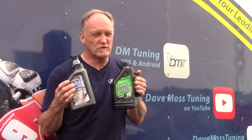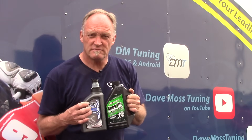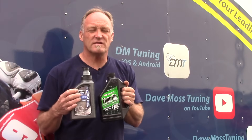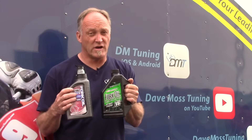Fork oil is cheap and you're supposed to change it about every 6,000 miles — 10,000 miles maximum. Would you keep your engine oil in for 10,000 miles? No. Change your fork oil too, because with age it breaks down and gets thinner, so the viscosity changes. You'd never leave your engine oil in over 10,000 miles — don't leave your fork oil in either.